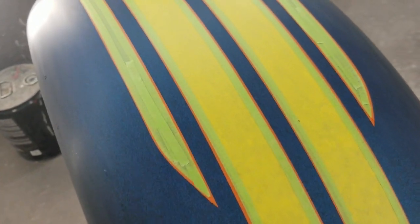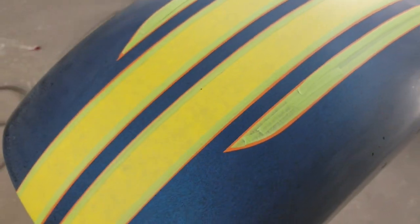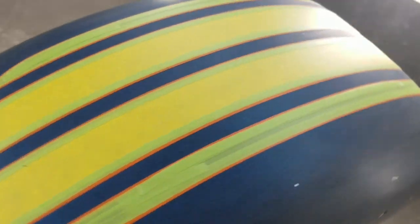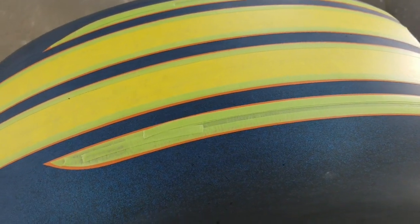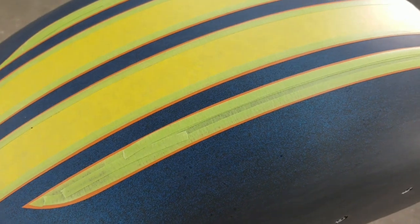Okay, I've got my graphics laid out. Always make sure you outline your graphics or flames in fine line tape — don't use masking tape because it will leave fuzzy edges. This is orange eighth-inch tape, my favorite for straight graphics. On cars with bigger areas, eighth-inch tape works well. For smaller intricate designs on motorcycles like flames, I always use sixteenth-inch tape — it's easier to make tighter turns.